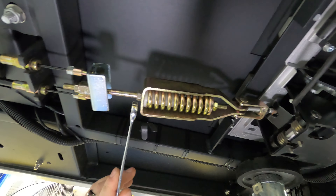Now we're going to jump up top and show you the difference we've made in the pressure gauge. Here we are again — we're going to zero out our reading and then apply the pressure again. You can see that our pressure is at least about 110 now, where it was right at 89 or 90. So you can see that we have increased the pedal pressure — the feel of the pedal — just by adjusting that one adjustment. We didn't have to take anything loose except the jam nut.